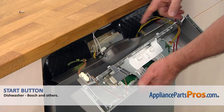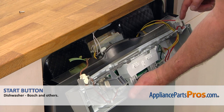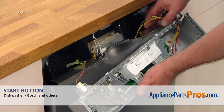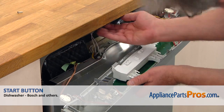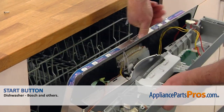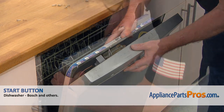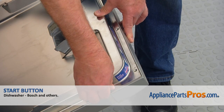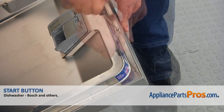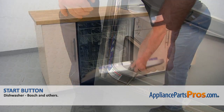We've got six slots on the door panel and six tabs on the control panel, so they're going to have to match. I'm going to open the door and install the control panel. Now we're going to secure it with the screws — place them in and tighten with the Torx 20 screwdriver — and now we can close the door.